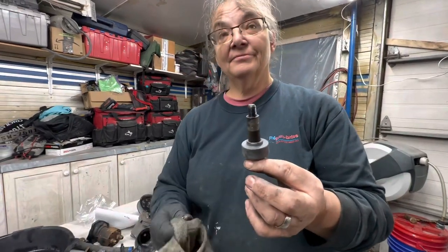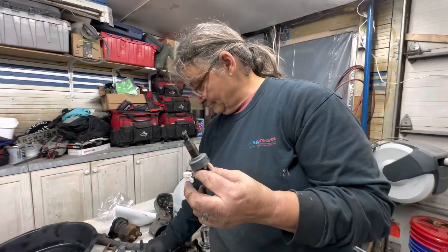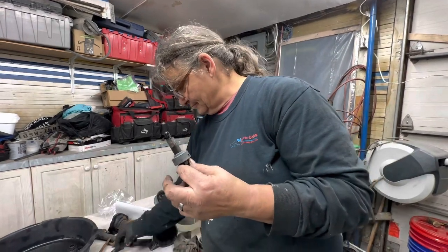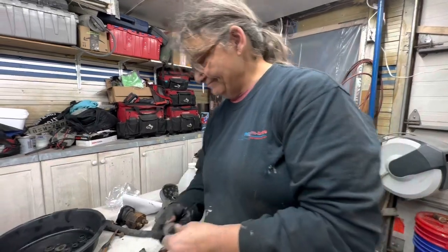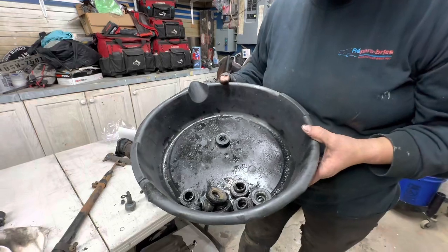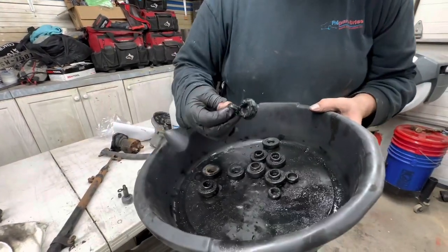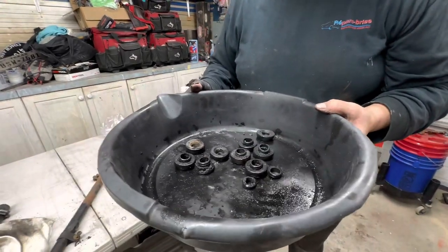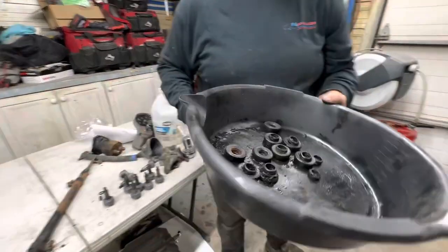And when you have an oil leak on your engine, like we had at the top, it followed the block, went down, and stays in that groove where the oil pan is and degrades those little rubber pieces. So we have little rubber pieces to throw away. They're not rubbers made for that, because when the oil falls, it degrades the rubber, since it's not made to be in oil. And obviously, the pan becomes loose, something we don't want.